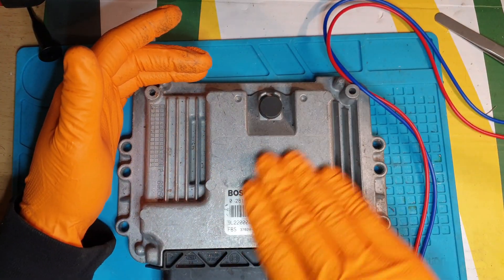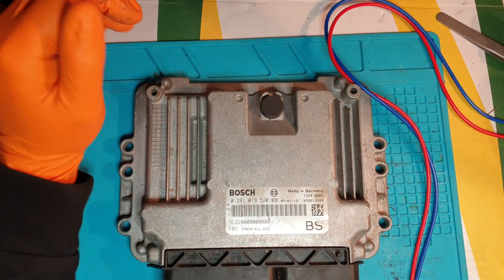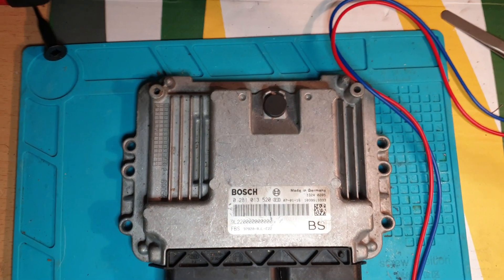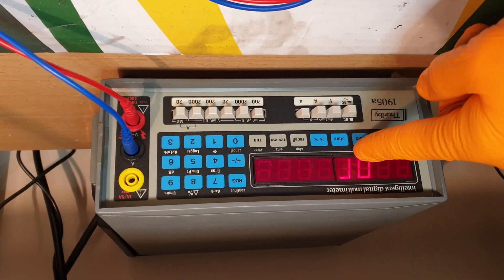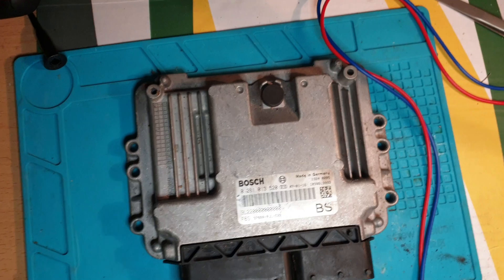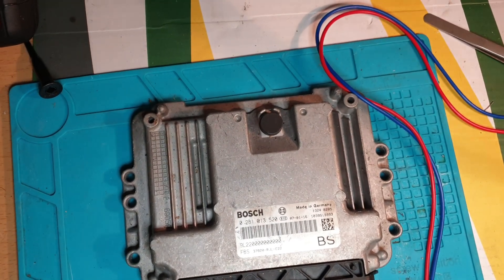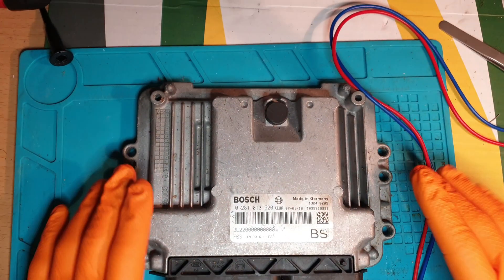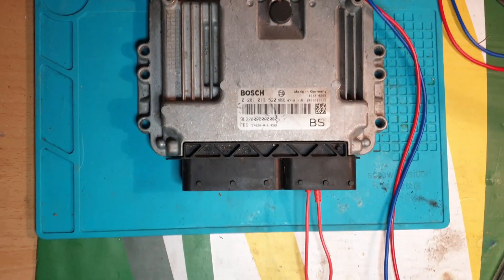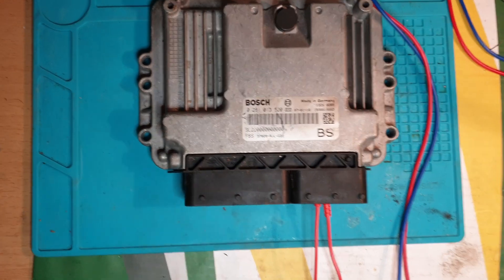It's completely open line — I'll show you when I take it off and turn the meter on. That open line reading is basically what it's saying. We need to look at this and find out why. In other news with this car, they called me in and I looked at it myself after they'd already blown this up, and I found a broken pair of wires maybe two inches away from the ECU. So it wasn't even the ECU that was at fault.